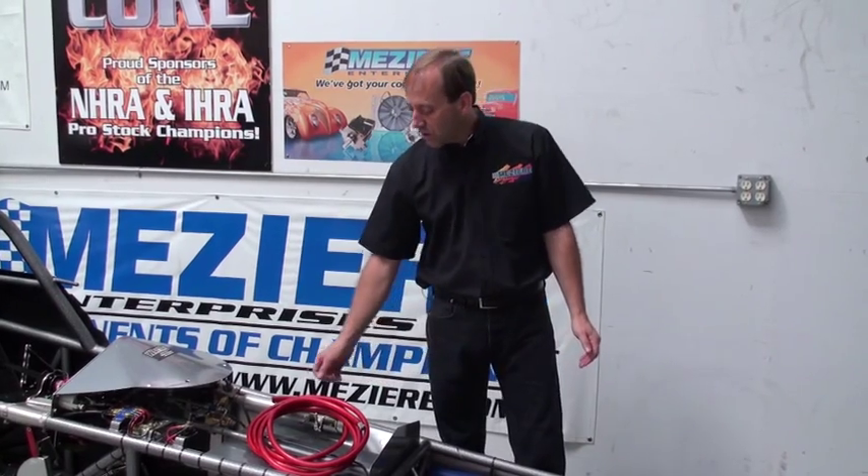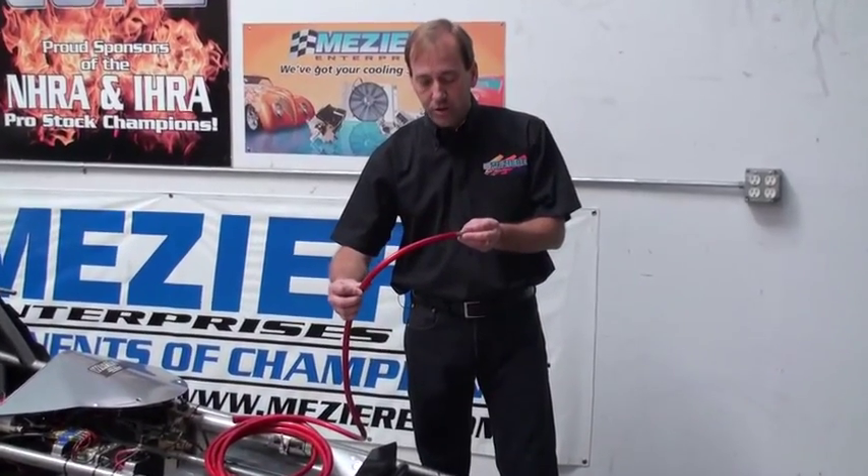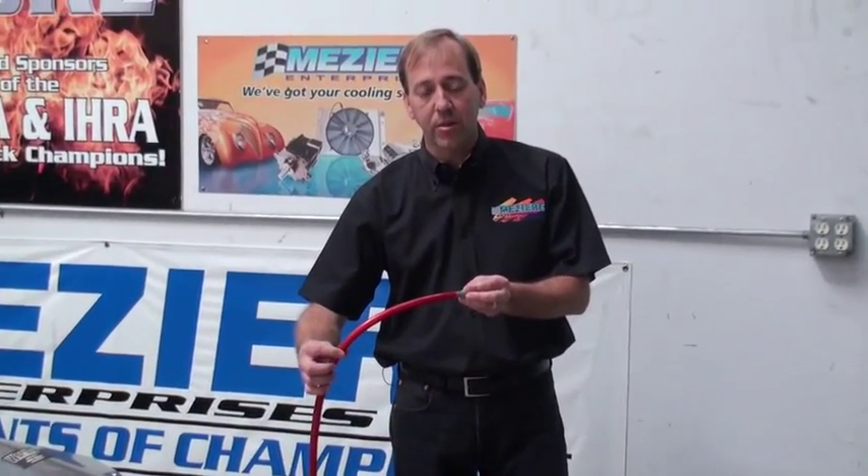It's quite common for these cars to be set up with cable that's too small for the job. We recommend 1 aught cable, fine stranded, high quality wire. So what we're going to do now is change that cable out and see how the voltage check improves.